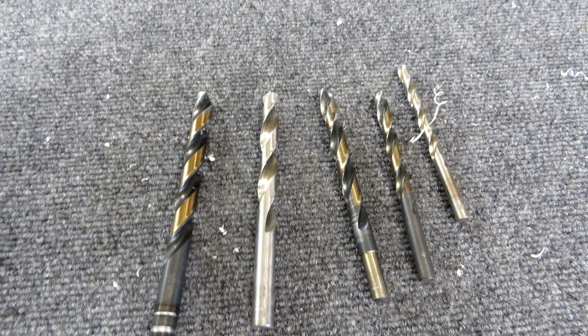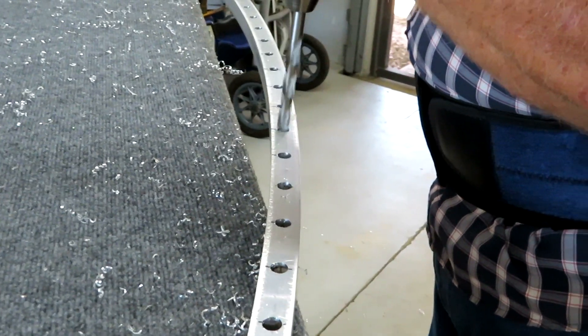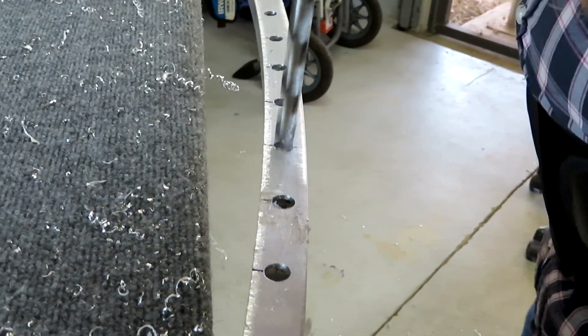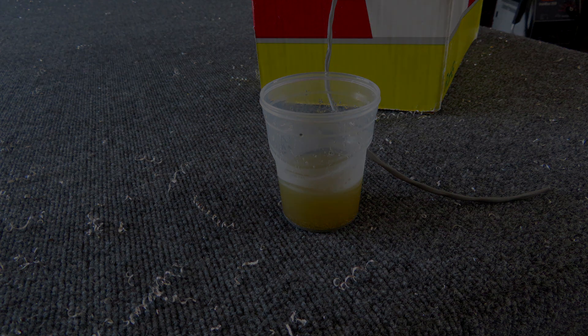Make sure it's a 12-millimeter for the LED, and then a 15/32nds. Right now I'm drilling the hole, making it larger each time I drill. The reason I do that is it eliminates the burrs on the inside that you can't get to to deburr. I use oil to help the situation out for drilling, to make the drill bits last longer.